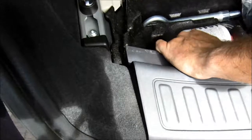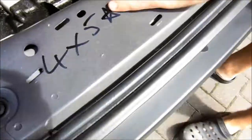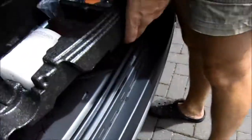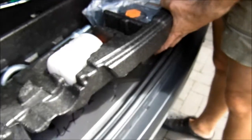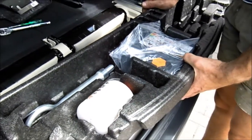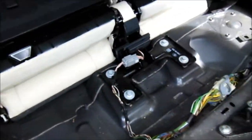The bumper's free here. Whilst we're at the top of the car, we'll grab this trim underneath - just give it a sharp tug up. All you're doing is freeing up these metal clips here that belong in the various holes on the metal panel at the back. Whilst you're here, you can also take this out. Our car here does not have a spare wheel - we've got the normal standard fit kit. This lifts out. If you've got a spare wheel, you may have to do something different in terms of the trim coming out. And then the electrics just plug into this hole here.